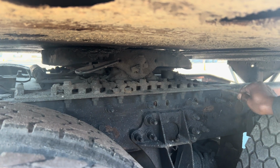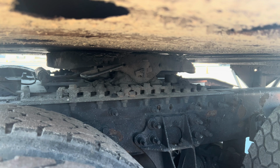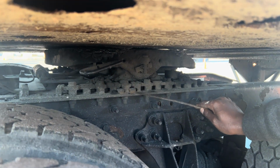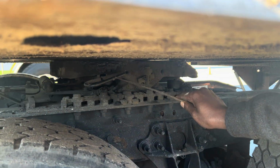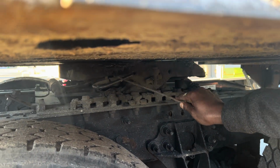Mounted and secured to the vehicle, not been broken. It's a sliding fifth wheel. You can say, I'm checking my sliding fifth wheel, mounted and secured to the vehicle, not been broken or cracked. It has 2 locking pins. They're in the lock position, okay? And that's my fifth wheel release handle, mounted and secured to the vehicle, not been broken or cracked. It has to be in the lock position.